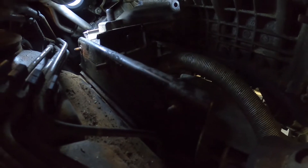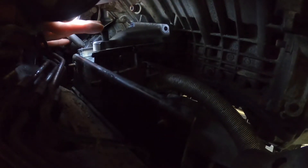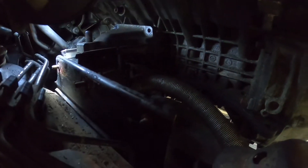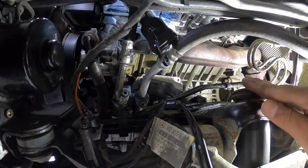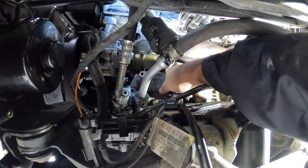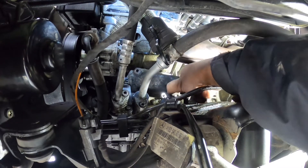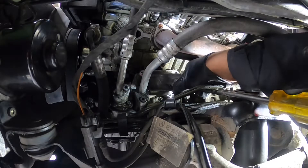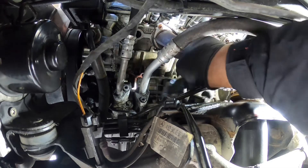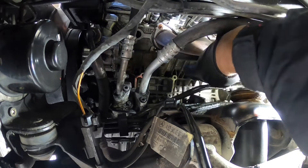My mount seems pretty much done — there's nothing much to it. Once all the bolts are off, I'm going to take off that bottom one I just loosened and then pull the arm out. The arms bolts are off and now we've jacked up the motor a bit. The arm should come off — the engine is still hitting it — there we go, it came off. Now just wiggle it to the side.